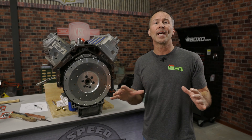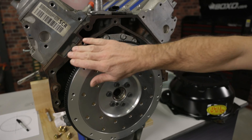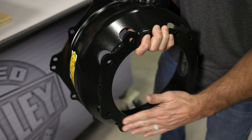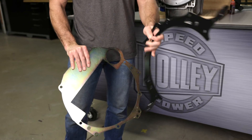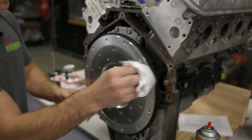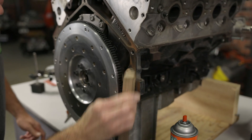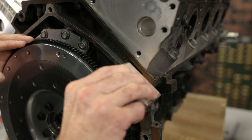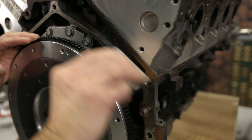The first step in indexing your engine's bell housing is to thoroughly inspect all mating surfaces. This includes the back of your engine block, both mating surfaces on the bell housing, and the front of your transmission. Don't forget to check both sides of your safety block plate or mid plate if you're using one. Clean the surfaces with a rag and some solvent, then use a wire brush to remove any corrosion or rust. Look for any nicks or imperfections in the mating surfaces. If you find imperfections, wrap a straight edge or steel block with some fine sandpaper and carefully sand them down.